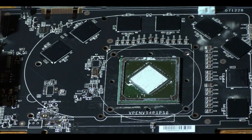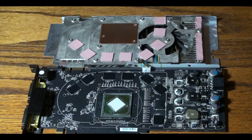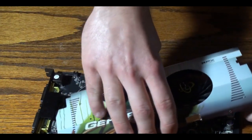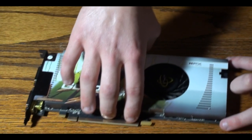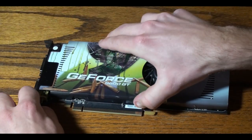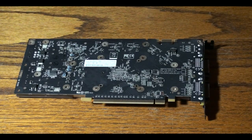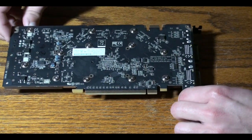That's what it should look like after you apply the thermal compound. Now it's time to reassemble the card. Just simply flip the top back over, just like you took it off. Make sure the top slides underneath the tab, and make sure it is seated flush to the board. Once you feel that it's right, flip it back over. Make sure all the holes are lined up, then just screw in all the screws again — and remember, in a diagonal pattern. Once you have all the screws back in, flip the card back over and you are finished.